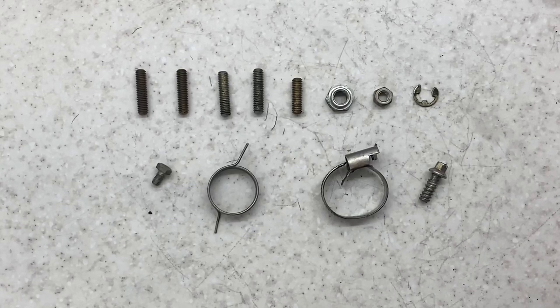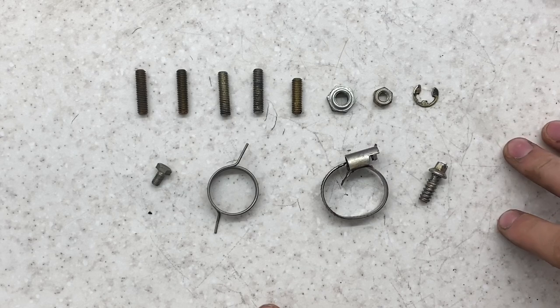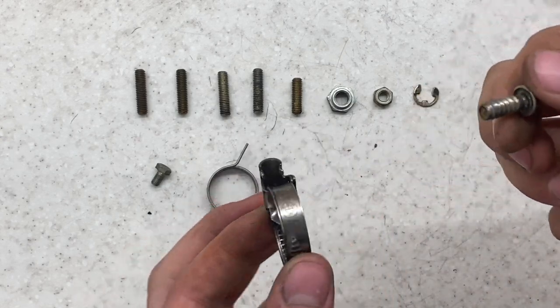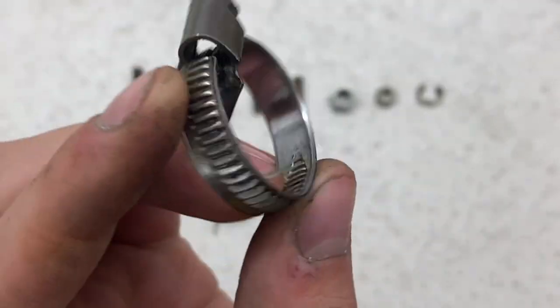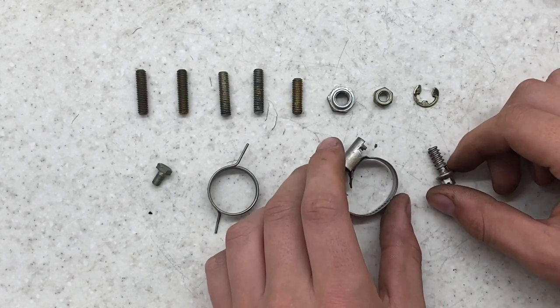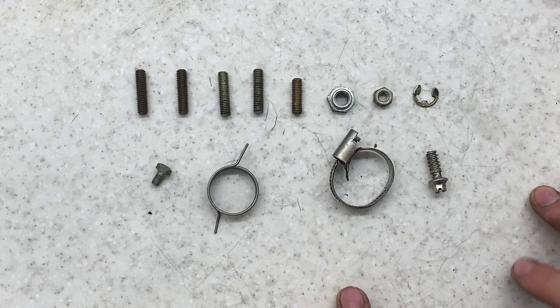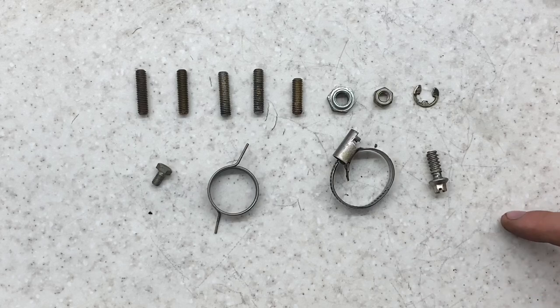Okay, so the next step in this process is for this part to get all zinc plated. I've emptied the box out and just to show you, I've also just stripped this down. I'm going to have a go at stripping it. I don't know how well it'll come up. It does look really cool. It looks in good condition. So I might give that a blue passivate, a clear blue passivate to make it nice and bright silver. The rest of these will be the yellow passivate.